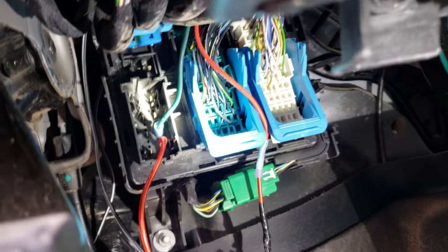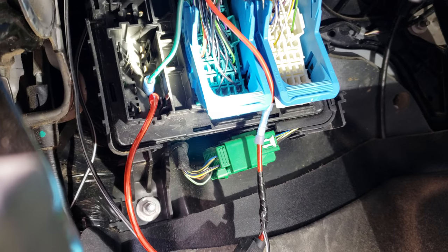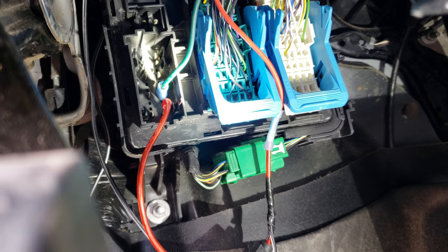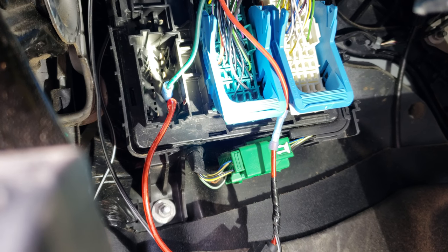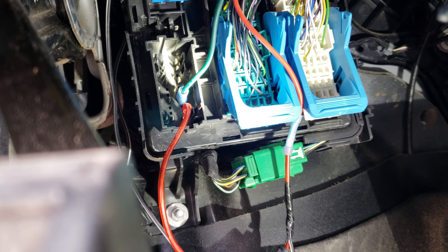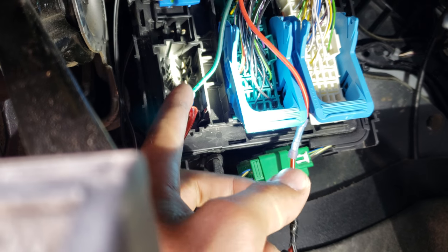That top pin right there, very top pin to the right — that's auxiliary 1. Now all you would have to do to find them is pull out your multimeter, hold your positive probe up to the pins, and cycle the auxiliary switches on and off with the key on. That'll tell you pretty quick what pins go to what auxiliary switch. You don't have to wire anything up to the dash or anything like that.